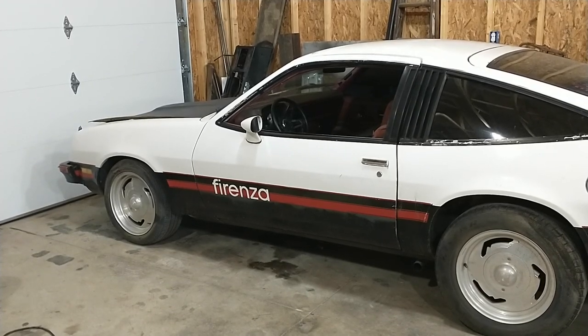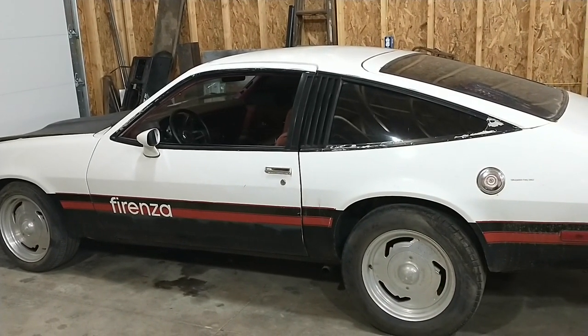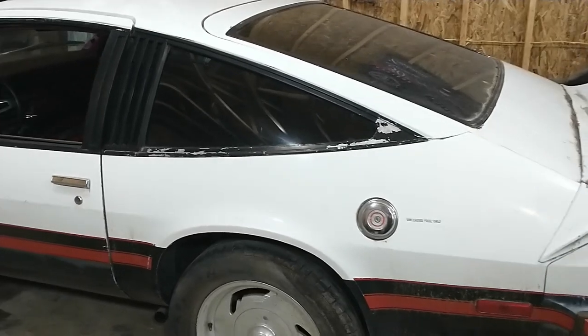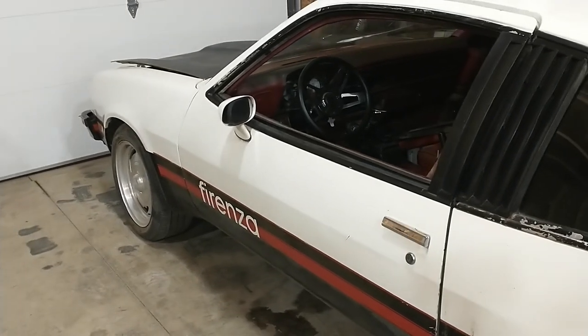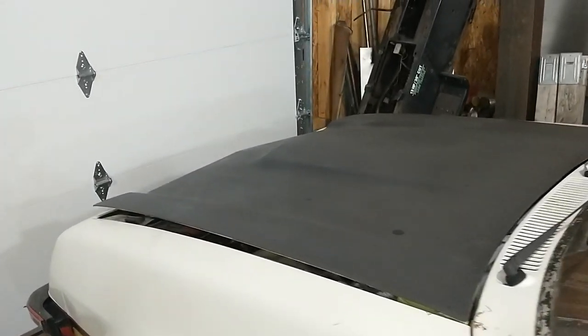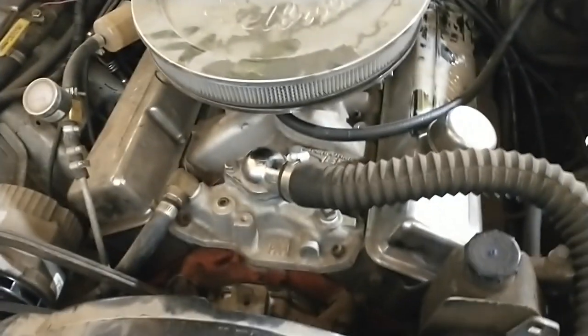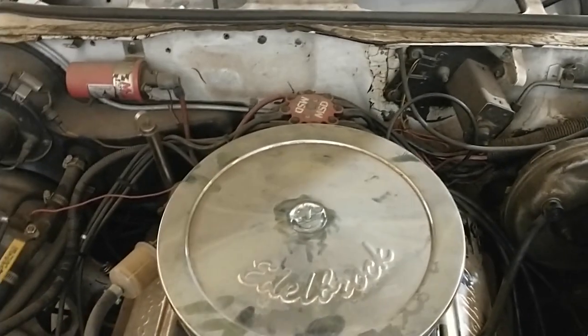The unique thing about this car is it's a V8 — it's a factory V8, and that's verified. Supposedly a four-speed; kind of looks like it might have been. Right now it's got a 700R4 in it. But I've got an original four-speed and an original pedal set, because this one's been kind of goofed up — they've taken the clutch pedal out of it. So we can put it back the way it was. The engine was a 305 originally, and that's long gone. But that's okay — this isn't like a Hemi-Cuda or something like that. Currently it has a 350, and that's verified — a '71, four-bolt main 350.